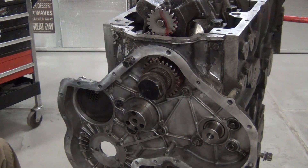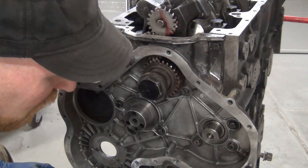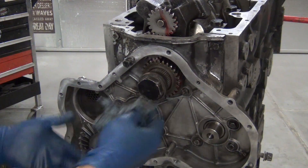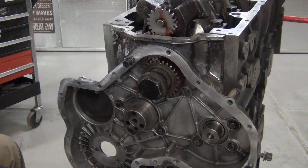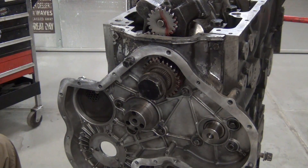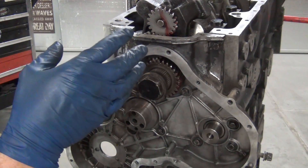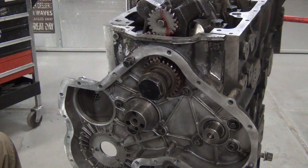There's the inner timing cover — no big deal. Once the timing gears are in, we can do the rocker arms and all that stuff without having damage or risk to the valves or cylinders. What I like to do is get everything lined up. Right now you've got top dead center — that's the way you line the gears up. All the valves are closed but the pistons on number one and four are right there. So you get your timing gears on, get everything set up, then rotate it so all your pistons are in the middle. This works on four-cylinder engines. Timing gears and camshaft positioned so that when you go to tighten the rockers on, you're not tightening a valve into a piston. It's just an insurance policy to be careful.